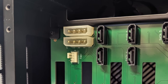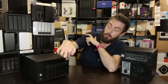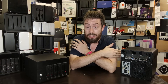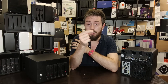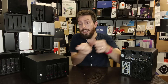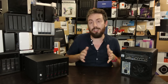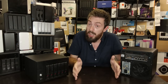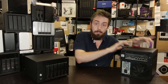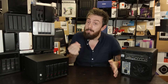You can get little adapters that fan out from a single Molex, or SATA-to-Molex connectors to power drives, but you're still dealing with a finite number of cables. Getting a more power-efficient, modular PSU means you can buy cables manually and be selective about the SATA, Molex, and board adapter lengths and quality you need. Yes, it will cost more, but in the long term it may bring that money back.